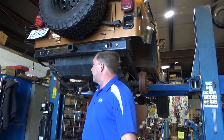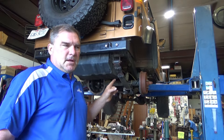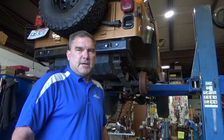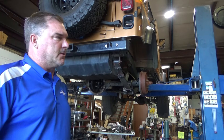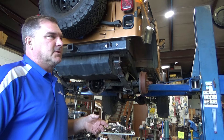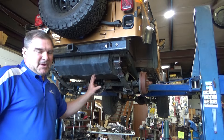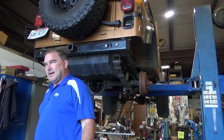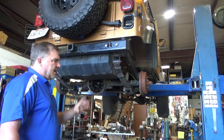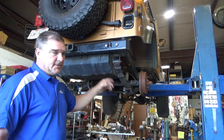Let's get the front wheels off. My brake pads and rotors are here. Then we can put our diff cover on and take it for a test drive, see if our springs being loose or our U-bolts on our rear axle being loose is what was causing our surging issue — because I think that's probably what it was. I also found some body bolts that were loose, so I went around and tightened up all the body mount bolts. They have a spacer on the inside, so they should lock down onto the spacer. Quite a few were loose.